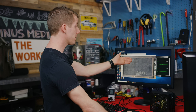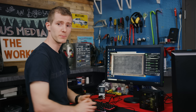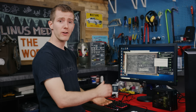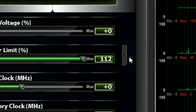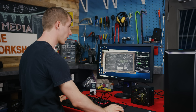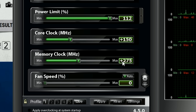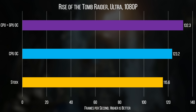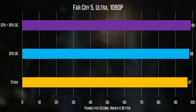My preferred strategy for GPU overclocking is MSI Afterburner in the foreground so we can make any adjustments we'd like, and some kind of stress test running in windowed mode in the background to monitor stability. You fire up Afterburner, grab the power knob, and rip it all the way to the max — in our case, 112%. Some older GPUs do let you go higher. Then you incrementally increase the core clock until the system becomes unstable. We landed on 150 megahertz for our core and plus 275 for memory, which gave us more than 10 frames per second increase in Rise of the Tomb Raider.